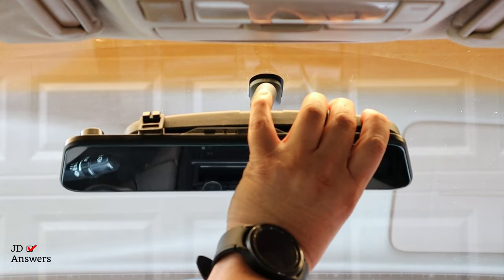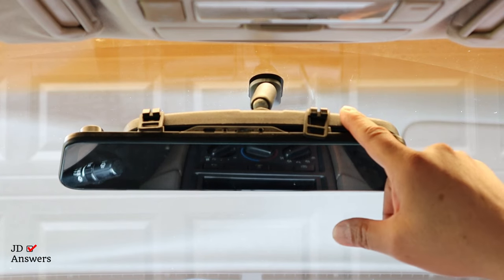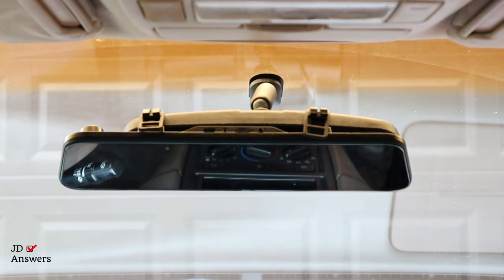Now what we want to do is start installing all the wires. We could route them later, but let's start with the wires now, because you always want to start from the front of the dash cam and work your way to the power socket for power, or all the way to the trunk area for the rear camera.